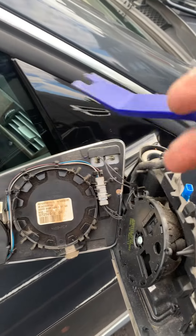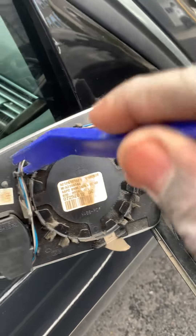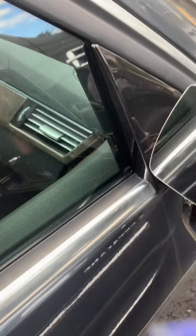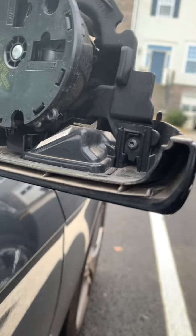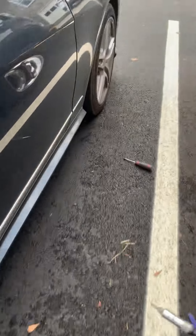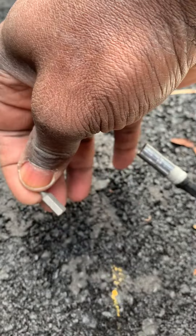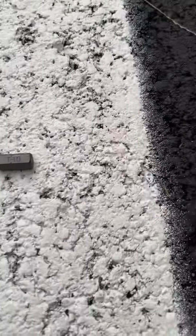You got to be careful you don't break these wires — the mirror, the turn signal, and all the other components that are connected there. As you can see, these are the small clips and they go in here. Let's straighten this back up and sit it over to the side. There are also two screws — these are two Torx, one here and one there. Let me grab the Torx. These are T10 — a T10 right there.